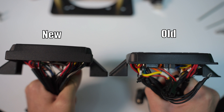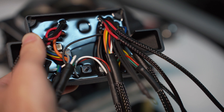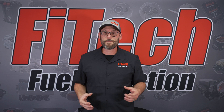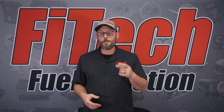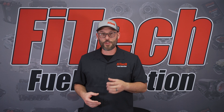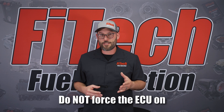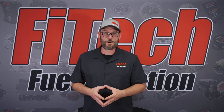You'll notice that the ECU you received will come with a set of screws and a brass spacer with a couple of seals. The brass spacer and two seals are for the MAP sensor. The MAP sensor is located in the bottom center of the ECU and may need the brass extension to reach the casting on the throttle body. Be aware that not every throttle body needs this, so do not force the ECU on because that will damage the ECU board and will not be covered under warranty.